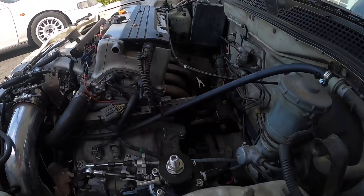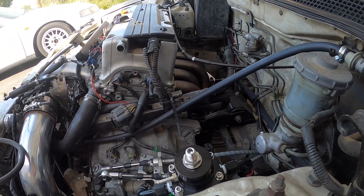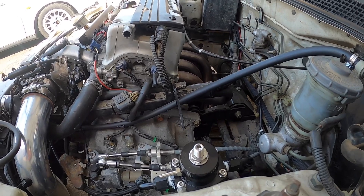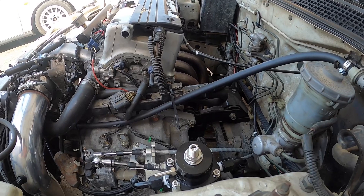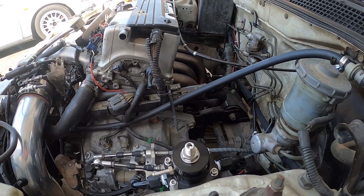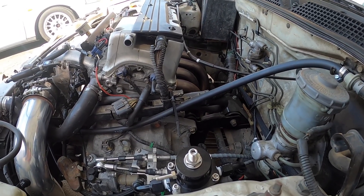I know there's been issues of axles popping out on stock five-speed RSX five-speed axles. We've used it on the Integra and never had a problem, so I figured we can use it on this — same style mounts. EG chassis versus DC2, right? Thanks to Young Static. I messaged him and he said swap out the inner cups between the two, left and right, and it might be okay. So let's try that.